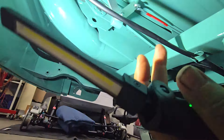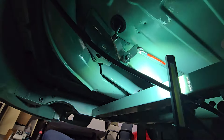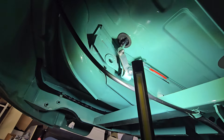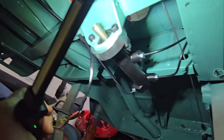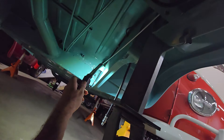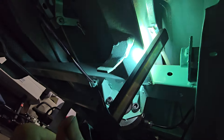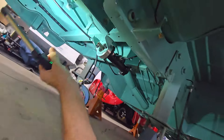The other thing while I'm under here: I went ahead and put together the throttle pedal assembly. You can see this little lever setup — this is the actual throttle cable running into the back of the car. These have an L-shaped swivel pivot that goes from the cable to this rod, which connects to the actual pedal. I also fed in the clutch line, which runs through a little dust seal to keep the tube that it runs through clean. It's just dangling here right now because I don't have the rest of the clutch pedal parts, but I'm getting those in the morning.